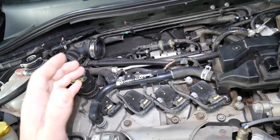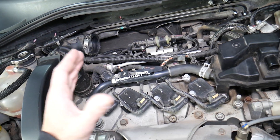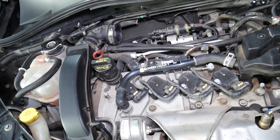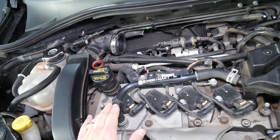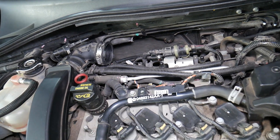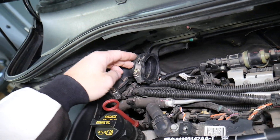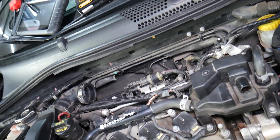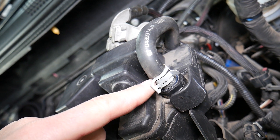The other case — more air with the same amount of fuel — can be caused by vacuum leaks. We have a special video that talks about vacuum leaks on Fiat and Alfa Romeo on our channel. Any place where the engine can develop a vacuum leak is a place where it can get extra air without the computer knowing. It could be a cracked vacuum hose, loose hose clamps, cracked intake boots, and multiple other things. But something that most people will never check is the PCV valve — a PCV valve stuck open can cause a vacuum leak and trigger that code.